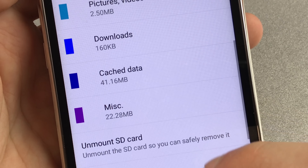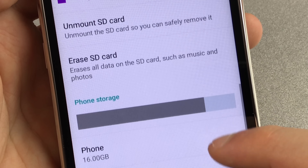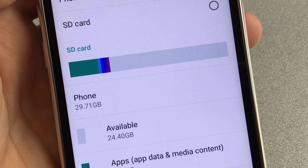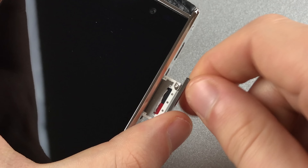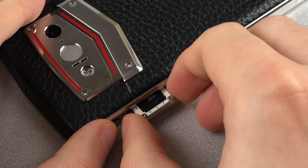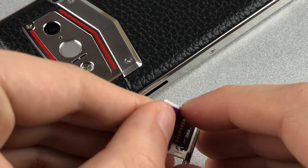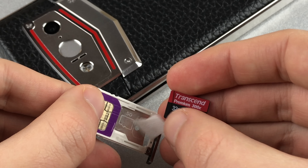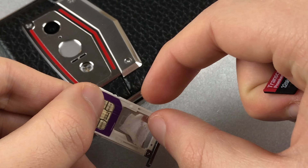The Leagoo V1 is available with 16 GB or 32 GB of internal memory. If that's not enough for you, you can always use a microSD card for expansion, but in exchange you will lose support for dual SIM. By the way, our unit got a little problem — it only recognizes microSD cards if we place a sheet of paper below the card, otherwise it doesn't make contact. We don't know if this is just a manufacturing fault or a general issue, but if you face the same problem, you now know how to fix it.